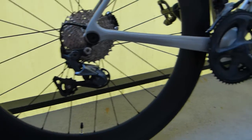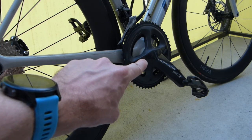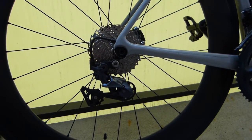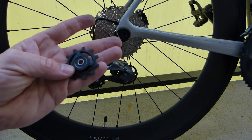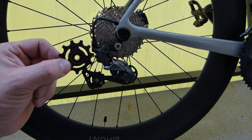If you do the math: every time the crank is turned around one full turn, there are 52 teeth on the large chainring, so the 11 goes into the 52 about 4.72 times. So they turn a lot, therefore they wear a lot.